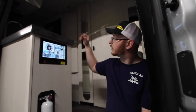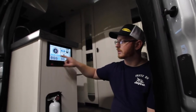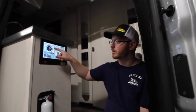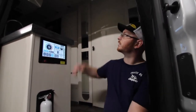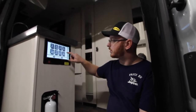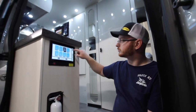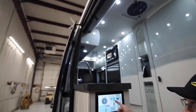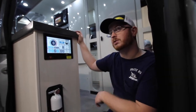With the fan set to auto, it adjusts to high or low depending on the temperature of the coach. That temperature is picked up from the little black sensor by the entry — the oval shape one is the temperature sensor for the AC gauge, and the round one is the temperature sensor for the furnace on the Truma system.